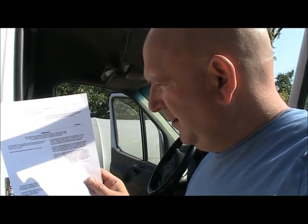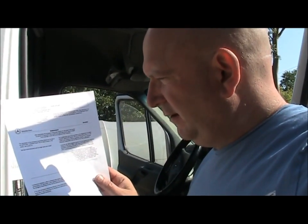You go in and say you've got this warning light on your dashboard because you've changed your double bench seat to a single seat and the computer doesn't recognize the middle seat belt is missing. They say no problem and give you a form — basically a statement about deactivating the emergency tensioning retractor. You fill the form out, give it back to them, and they send it to Stuttgart in Germany. Germany then gives them a code, you take your van in, they put it on their star system in the workshop, enter the code, and it takes off the warning light on the dashboard. I'm pretty certain that warning light is an MOT failure, so it's worth getting done.